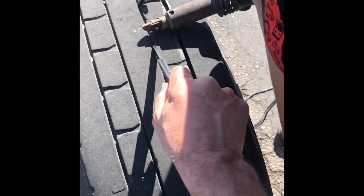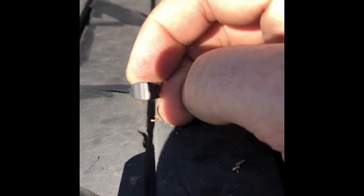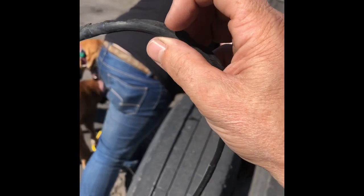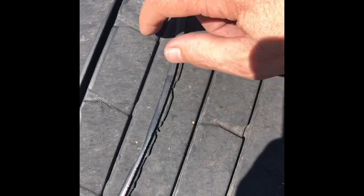It's as simple as that, and then we're going to go through and cut this one — cut the ends off of those. Look at the depth. All of that from that point to that point — that's how much more tread is now available down in the bottom of that groove. This is what's left right here, this is what comes out. That gives you an idea how much deeper this tread is cut. This was the bottom of the groove — it's now that much deeper, that much more tread sticking up.